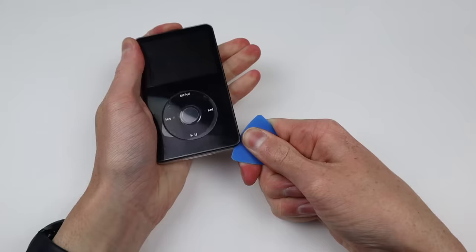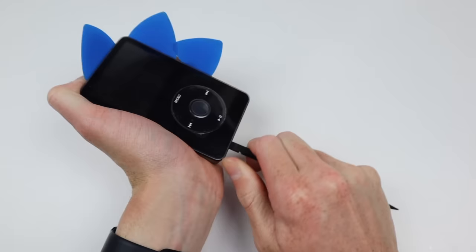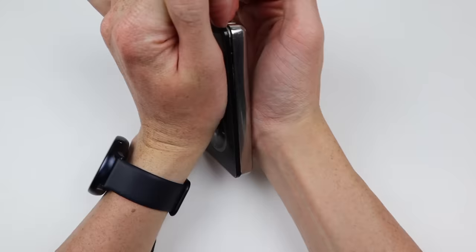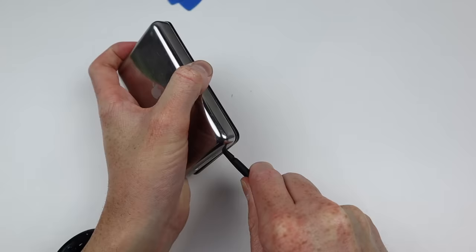The first thing I'll need to do is open up the iPod, which is a little bit more difficult than other tech gadgets. This one has never been opened before, so it actually took a little bit of prying to get it open. I used a range of different plastic picks and tools to wedge my way in between the front faceplate and the back. It uses really strong clips along the sides and one up the top. After about 15 minutes I was able to create a gap, though I bent one of the clips on the side — an easy fix with strong tweezers.